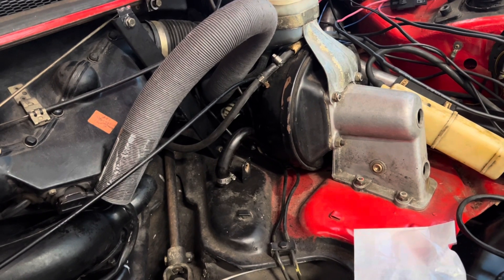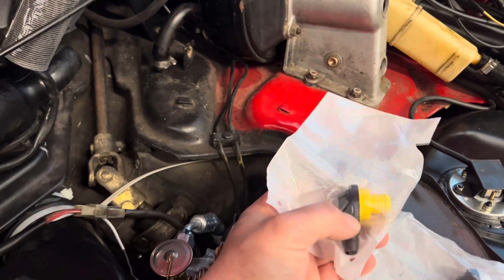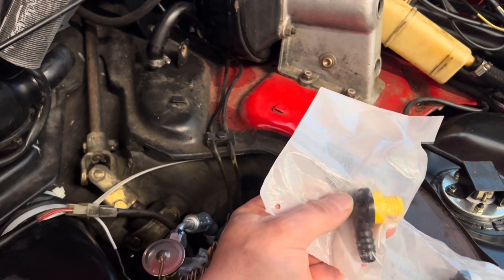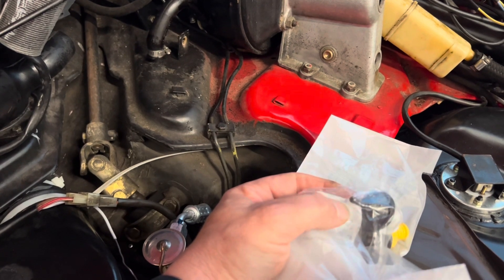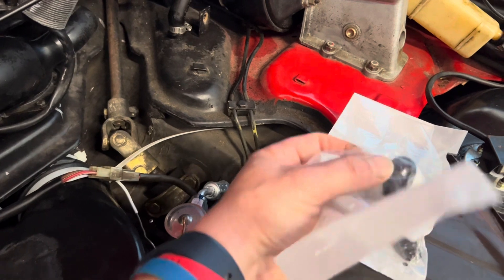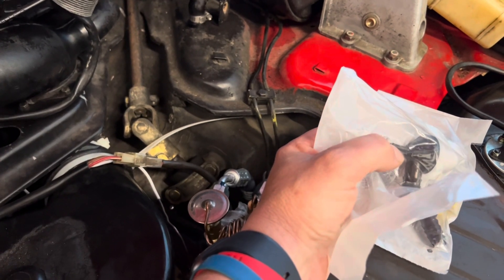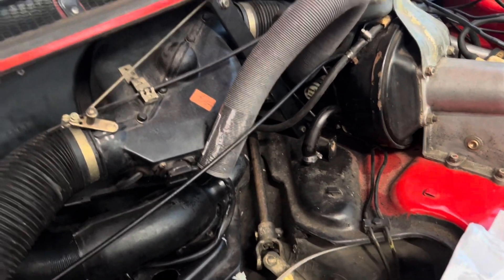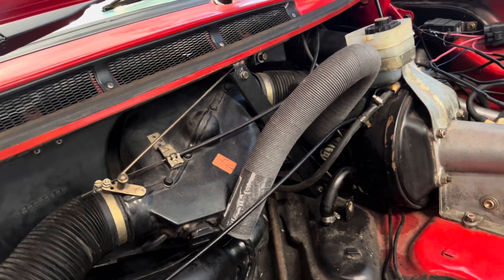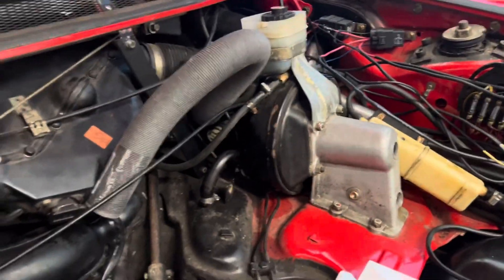And then I had an epiphany — I did this 10 years ago in my own car. So this is your stock standard brake booster valve. You'll notice it's got one attachment for a vacuum hose and then it goes into the brake booster. This is your little check valve. This one is also a check valve, but it has an unmetered air nipple on the back of it — non-checked, if you will. I believe this is from a 944 Turbo. This is where you can get your boost signal for your mechanical boost gauge. The mechanical boost gauge is right behind there — maybe 18 inches of hose, maybe 12 inches. So instead of this giant run of hose that goes all the way to the back of the engine compartment where it's all crispy and cruddy, this is the solution.